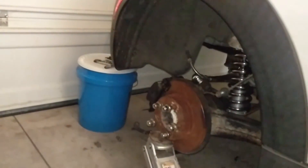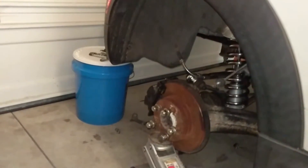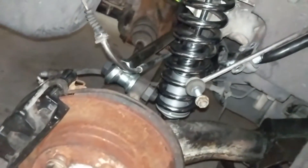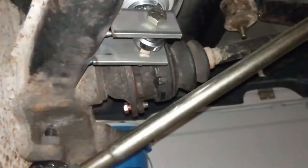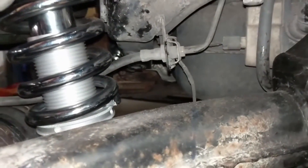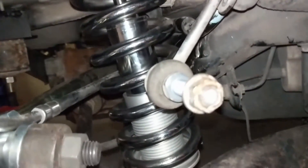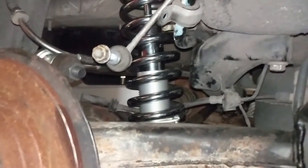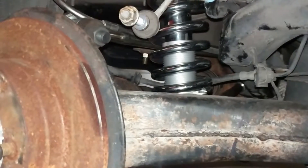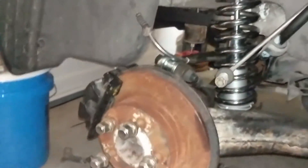That's right where that rear corner starts to lift, so if I lower that back down — that's pretty much what we're looking at with suspension. Those tabs on the bottom right now aren't fully welded, just tacked to hold it in. Now that we've confirmed fitment and alignment, and checked our clearance at max droop as far as what the suspension is capable of — and of course we're going to limit it with limiting straps — as it compresses we do continue to have clearance and the suspension tucks right up nicely. So let's get that finish welded.